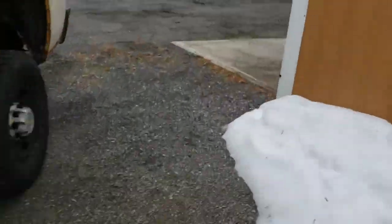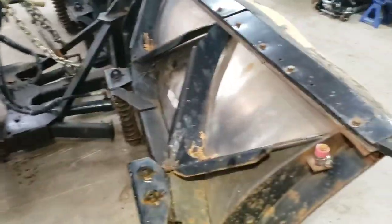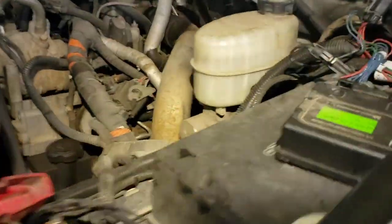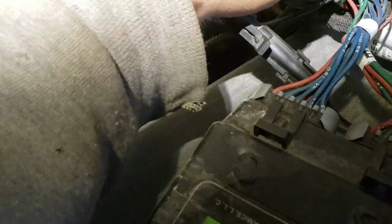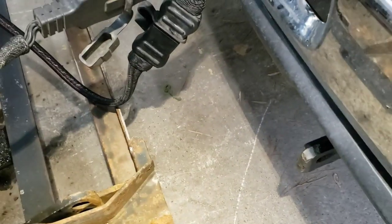This is the truck set up as a backup - I just got a plow here for testing purposes. This plow's in rough shape but it works. I messed around, switched out the module. I checked the fuses, checked the voltage, we're getting 12 volts. First thing I did was check your main power plug and on a test light it was getting ground and power. Everything seemed good - the fish stick controller was lighting up but when I clicked it, it would shut off after doing its clicking thing up front.